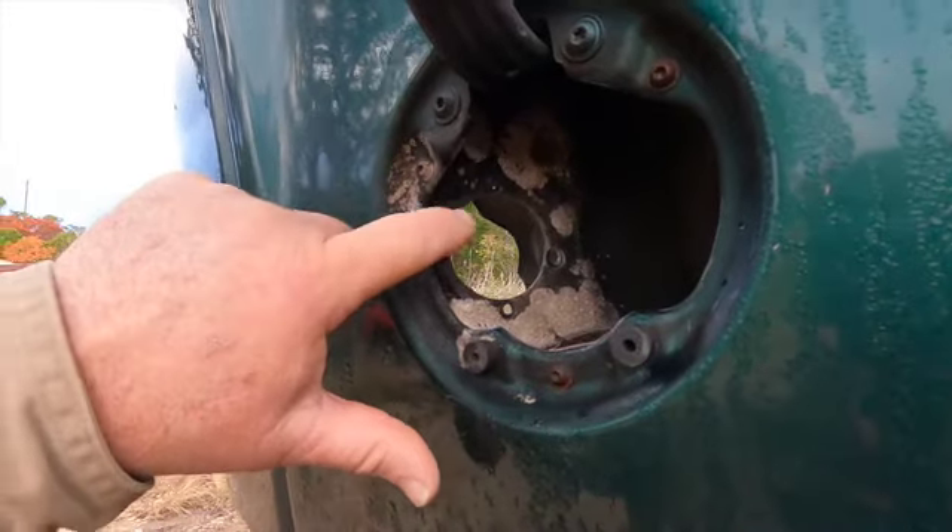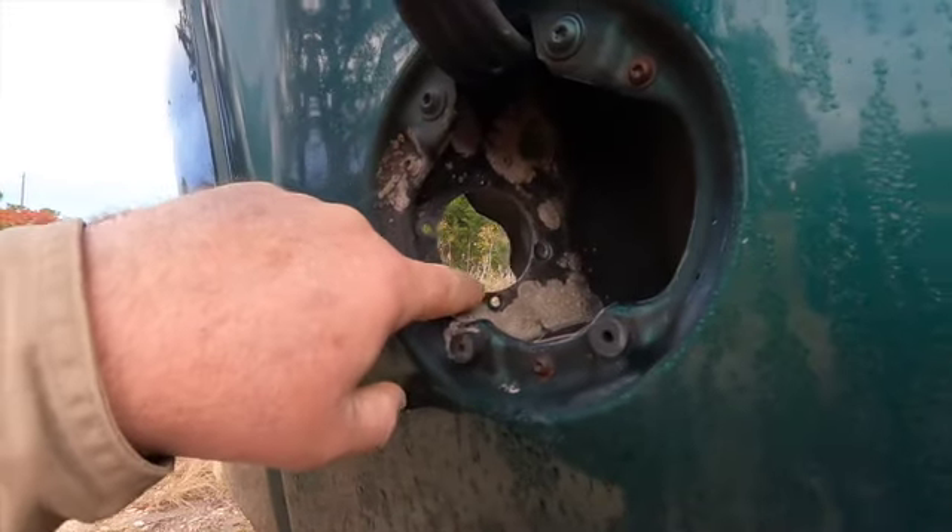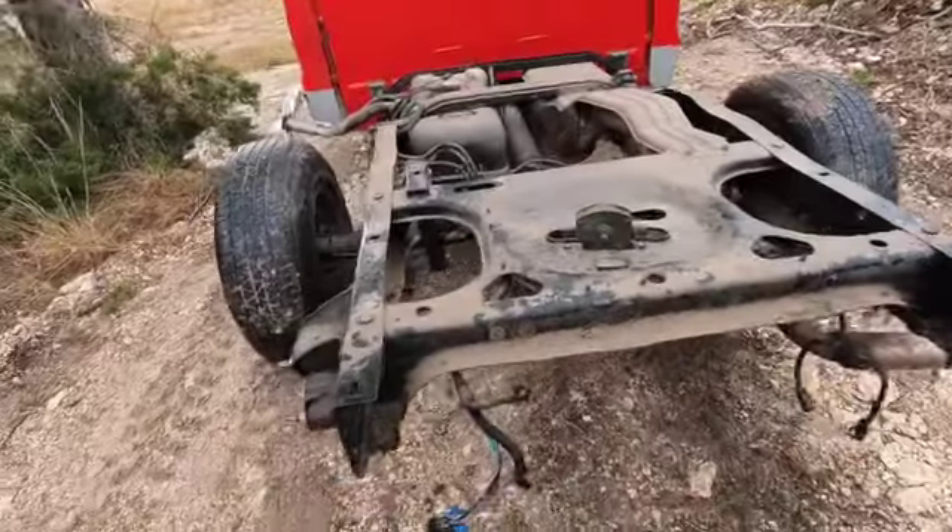The filler neck has four bolt holes — a Phillips number two will do that for the filler cap. Shove a rag in there after you take the cap off. Make sure the rag doesn't go so far as to get past the flap and tear off into the tank. I prefer a blue shop towel from a parts store over a regular paper towel, since a paper towel is going to dissolve a lot easier and quicker.